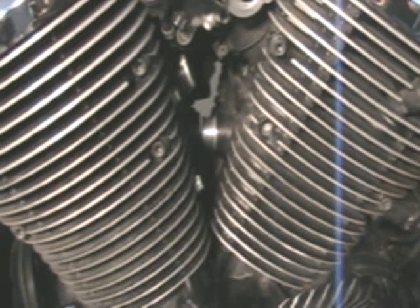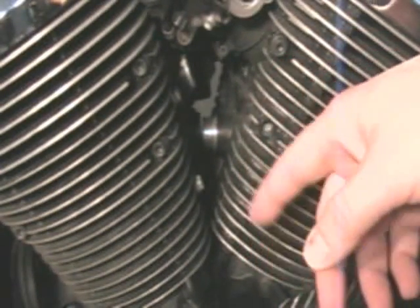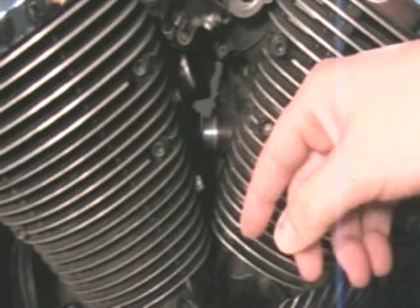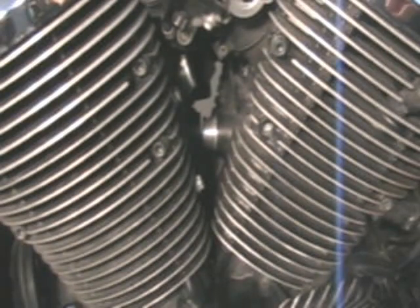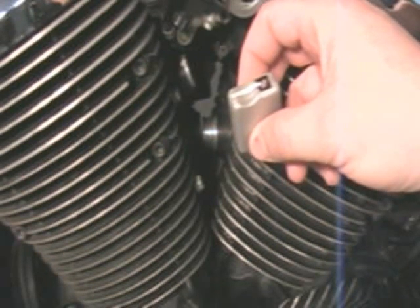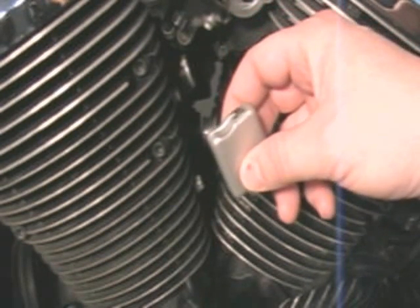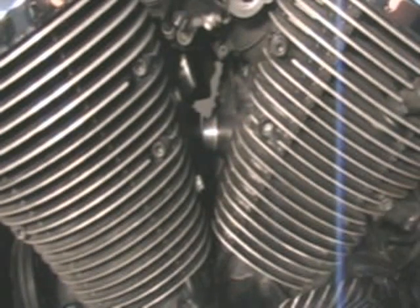A pick is fine for the old O-ring because we're replacing it, but you don't want to use a pick on the new O-ring because it'll nick it. If you've got a nick in that O-ring and push this tube back in, you're going to have a coolant leak still. So here's the trick: dental floss. I picked this tip up from a fellow online known as Old School Soldier off of the Honda Shadow forum — HondaShadow.net. He's got a write-up of this in there. It's a great idea and I'm going to use it because it works.